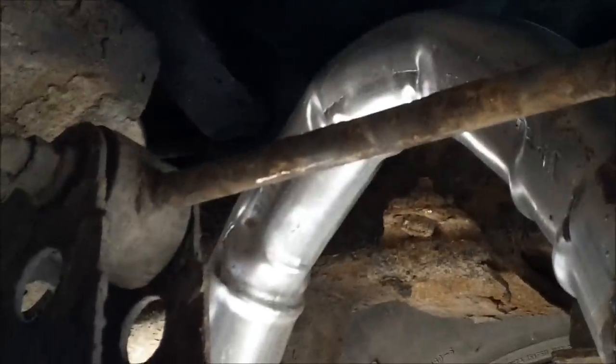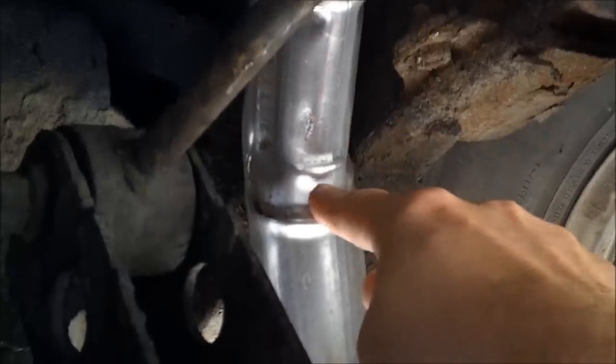The bends on the bit over the axle were quite difficult. There was quite a bit of caving in around the inside of the pipe where it was pushed up inside the pipe bender. That was despite packing with sand and capping at both ends and compressing it. I've done a few slash-cut welds to get the angles correct, to save a bit of pipe bending and messing around.